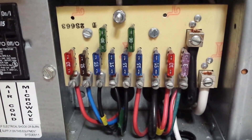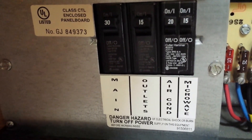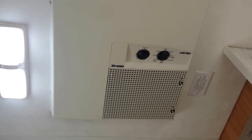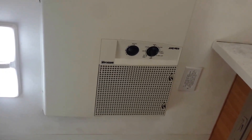I'm down here - might as well show you this. Never had an issue with these fuses. You've got 120-volt fuses and then your 12-volt. I did have it plugged into the garage testing the heater and it tripped my 15-amp fuse in my garage. I suppose because this unit is set up on a 20 or 30 amp - my garage was not able to handle it.